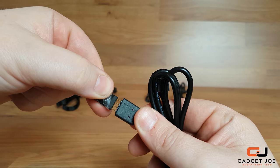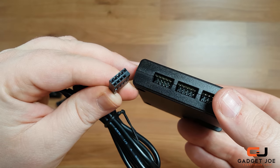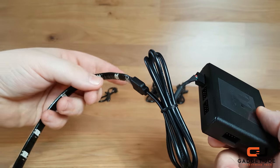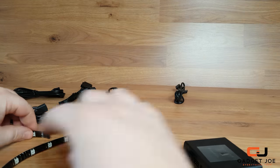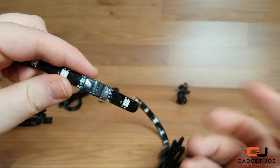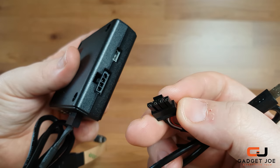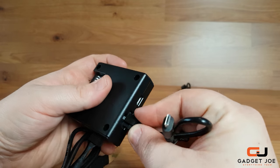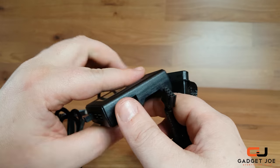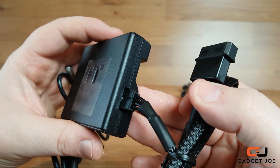Connecting the strips up to the controller is simple. You take the end with the 4 pins and simply slide it onto the connector on your LED cable, and then the end of this slots straight into the controller. Connecting extra strips is as simple as repeating the same steps and plugging into the controller. You can also join the strips together and use one slot on the controller with the same effect. The bridge cable connects this controller to another controller via micro USB, and power comes in the form of Molex connecting to the PSU.